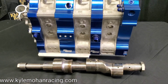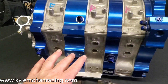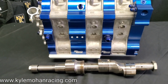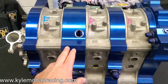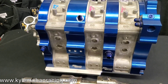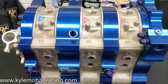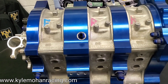This has given consumers like myself, racers, and enthusiasts the ability to build motors that, whether they're complete billet or a combination of parts, we now have supplies in the world to recreate 20Bs and four-rotors. That's one of the big achievements that billet rotary companies like Billet Ink have given us. You really could just buy a billet center, gear, and shaft, and then the majority of the other components could be based off of your traditional 13B components.